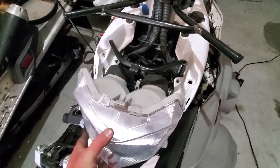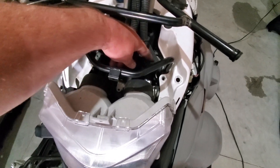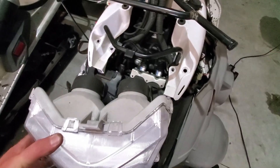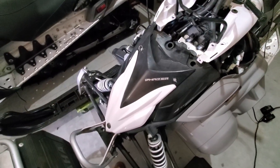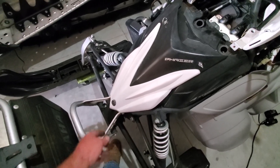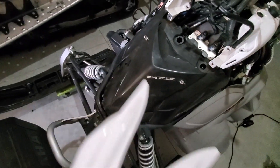Then you just pull the headlight forward — it has two wires attaching at the back, one here and one here that hook to the back of the headlight, one to each bulb. Next you'll want to take this piece off here — in my case it's white. There's a release down at the bottom, just a rubber strap. Pull that loose, lift it up, and it pops right off.